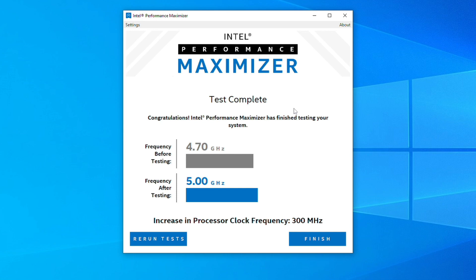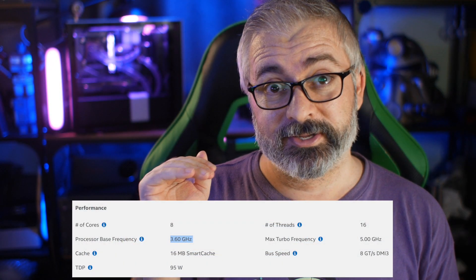That's quite a lot of free performance. The base frequency of the i9-9900K is 3.6 gigahertz, and now all cores are running at 5 gigahertz. To be fair, the i9's turbos normally keep all cores at about 4.6 to 4.7 gigahertz anyway, so it rarely sits at that 3.6 in practice. But even using 4.7 as our baseline, that's still a significant overclock that makes a noticeable difference in performance. I'm not going to go into detailed before-and-afters — the i9-9900K is a seven-month-old CPU and there's plenty of info out there. Suffice to say, more speed equals more better.